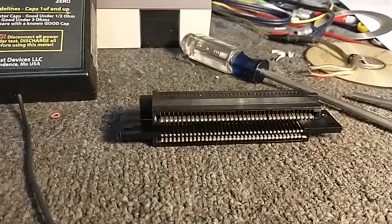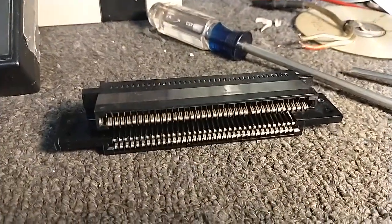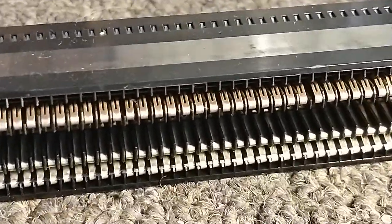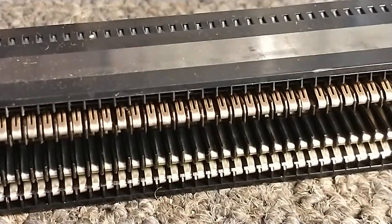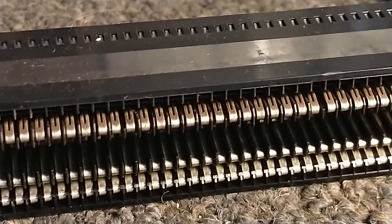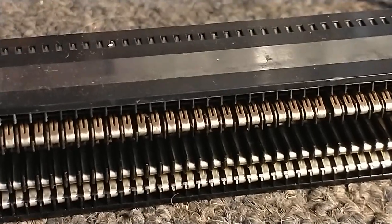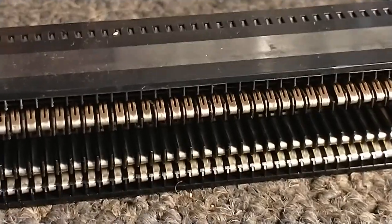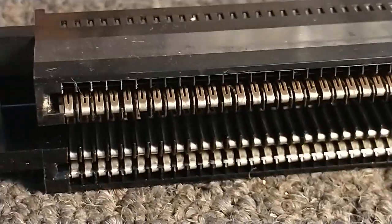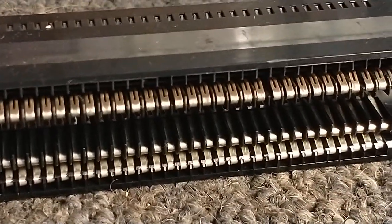Here is the old 72-pin connector I pulled out of my NES-001, first edition, 35 years old, with bazillions of hours of playtime. Let me zoom in and adjust the lighting. You can see the shiny parts at the ends of the connector — that's your contact plating. That's what makes the connection. The duller area is just the metal behind the plating, and as you can see from start to finish, the plating is literally just worn away.